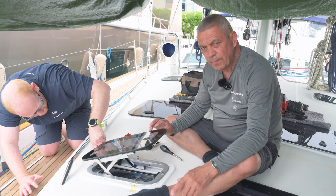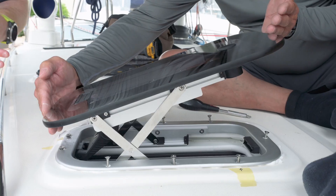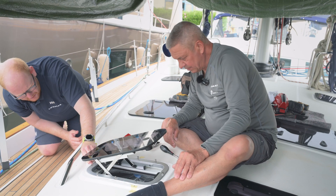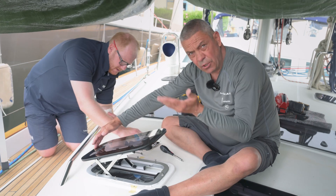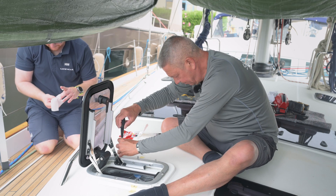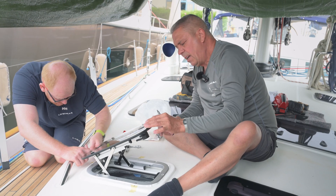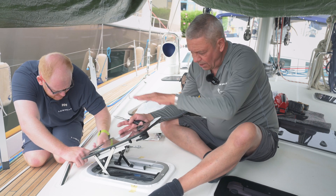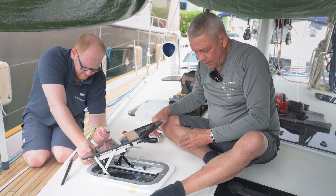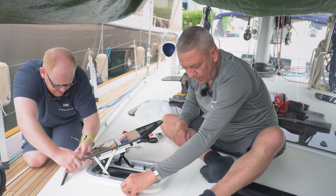We're just cleaning the back edge off. You'll notice the back edge actually falls beyond the edge of the frame, and where we've got the SikaFlex it has oozed out nicely at the back. You don't want the SikaFlex to pick up on the back of the frame. At this point, you can lift the frame up and carry on with the remainder of the fixes. It's a little bit tricky to get to the two rear screws, but as long as you start them, you can close the lid slightly and the gap opens up bigger at the back. You'll notice the SikaFlex is oozing out, which means you've got a good clamp and a good seal.